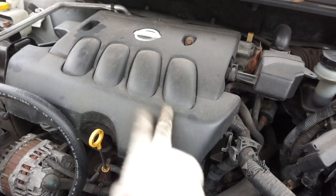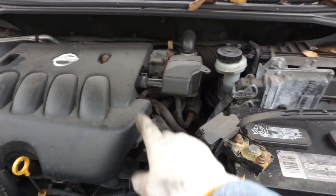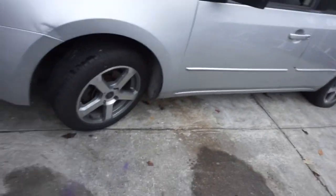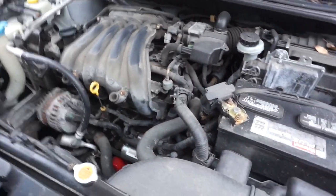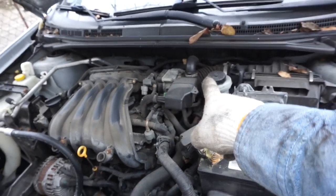So we literally need to take off bolts from here, bolts from back there. We need to take off a vacuum line, throttle body, and the intake and everything just to put in coil packs and spark plugs. So stupid. All right, car is on the floor, wheels on. Now we gotta attack this. So I was telling you guys the manifold goes from there to the side, I have no idea. So I'll take these bolts out, bolts back there, bolts over there, throttle body, intake.